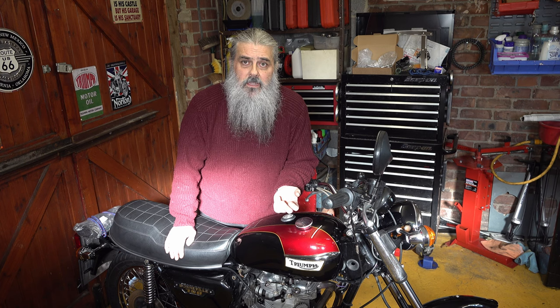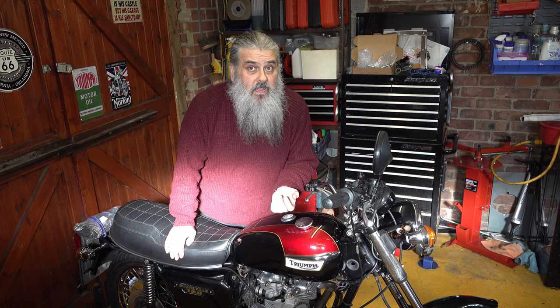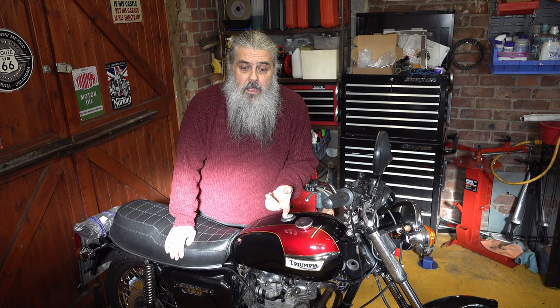So I thought I would do a leak down test to follow that up, just to see if there are any leaks from which I'm losing compression. I don't think so because the bike is starting and running absolutely fine, but as I have the equipment to do it, I might as well. So I'll show you how I do that now.